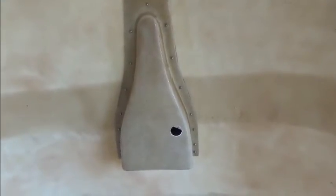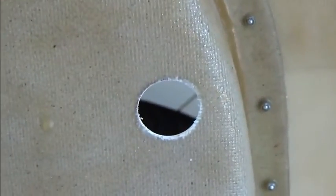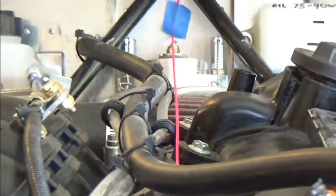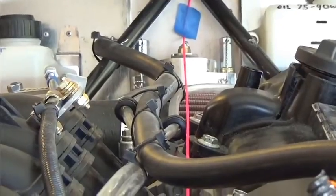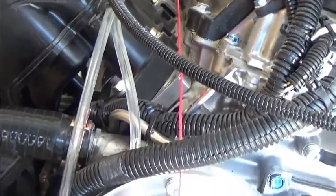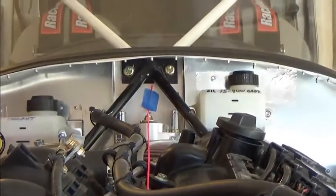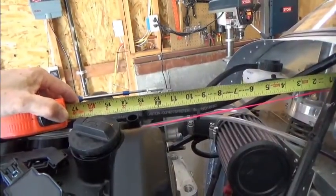Once you get this inlet installed, you calculate and measure what's needed to drill out that dipstick hole. I've established a center line via a string from the very center of the back of the firewall right above the steel bungee, brought all the way over to the front of the prop hub — so I have that pretty close to center. Next I'll show you how we're going to measure where to locate the dipstick hole.